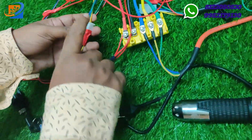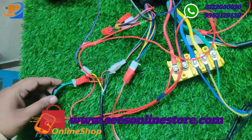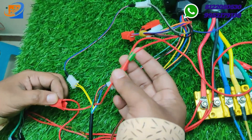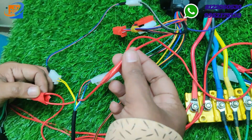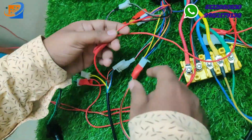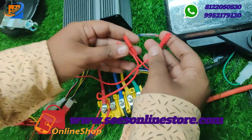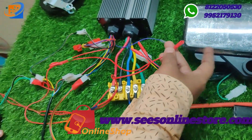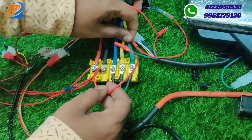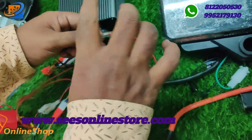For the hall sensor connection: red to red, black to black, blue to blue, green to green, and yellow to yellow. For the power key, there are two wires — one red and one green. The DC-DC converter supply connects on one side. The green wire here is the negative of the supply; the black color wire here is purple or violet — that is the speed sensor connection.